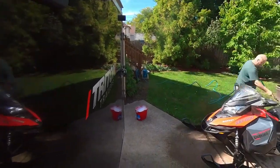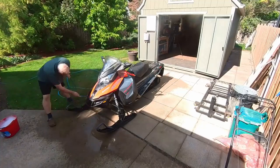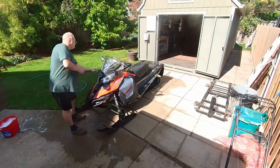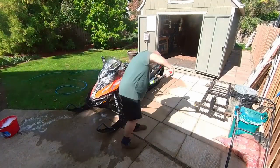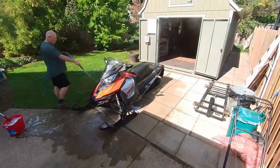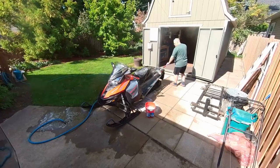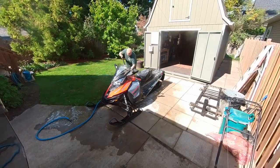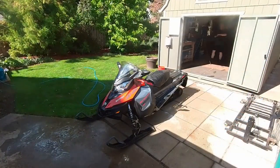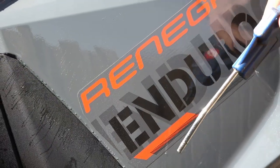I know I've washed quite a few different things on this channel, and I always say the same thing, but I believe it is worth reiterating here. When you're washing power sports, you want to be careful when you're using your water, and you'll see here that I am not actually using a pressure washer on my sled, I'm just using hose pressure. I'll use a soft brush to do the general wash over with just some regular automotive soap. But I want to be sure, especially when I come to the suspension, that I'm not forcing water into any of the bearings under there.